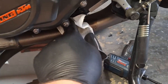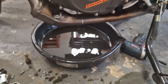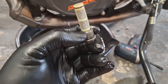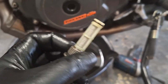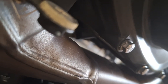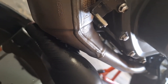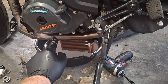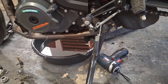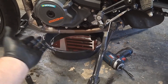Get all this oil off the exhaust here to avoid smoking. We do have one more plug to go — the 13 millimeter head with two O-rings that have been wetted. Stick that in right there, thread it in by hand — do not cross thread. That 13 millimeter drain bolt is tightened, so is the 18, and the canister oil filter housing on the other side has been tightened. Everything's been wiped down, so at this point I'm going to clean this mess up and get the panels back on the bottom.